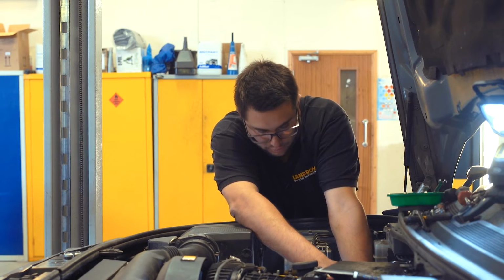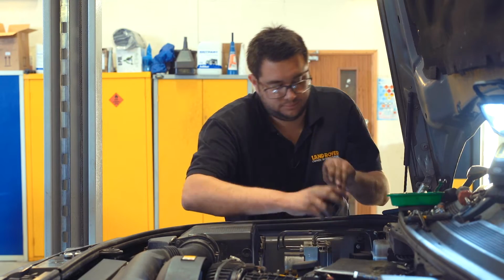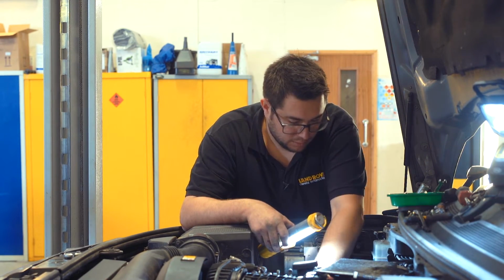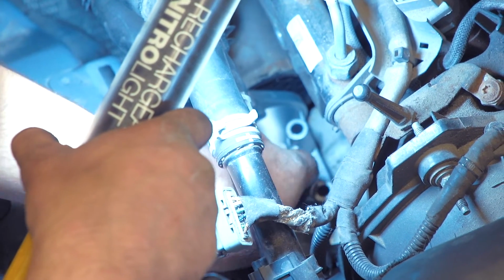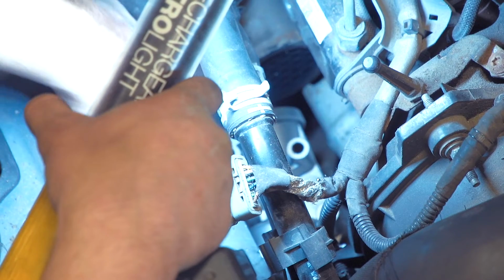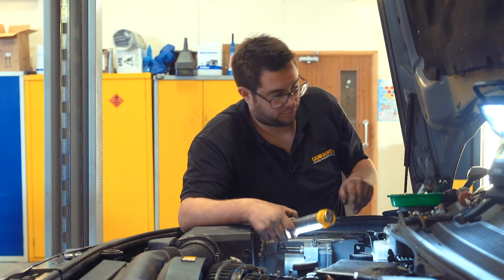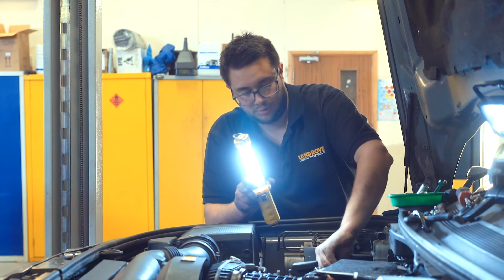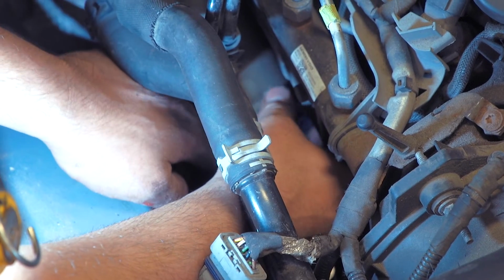Let's push that through the cooler, withdraw the magnet. You need a bit of a gap between the valve and the cooler at this point, obviously, to fit the gasket. So just sit that back, push the screw through, slide the gasket over the screw, and now we can offer the valve up to the cooler.